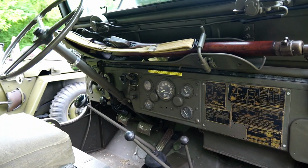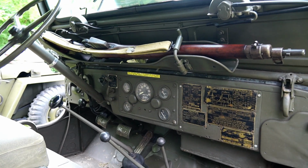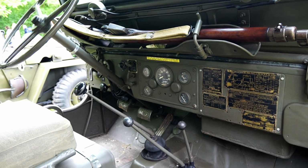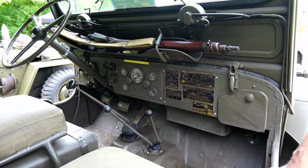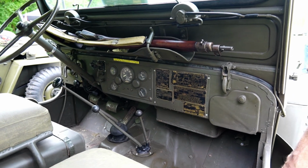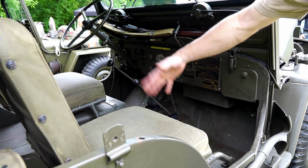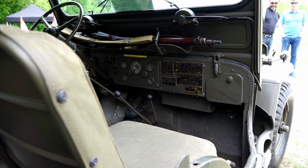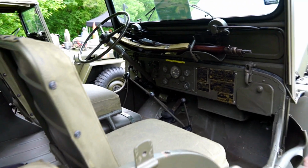Do you roughly know what the gear ratio is, especially in the first or second? Because I guess the third gear is the cruising gear. Off the top of my head, no. I'd have to look it up. The rear axle ratio I know is 5.38:1. So it's very, very low gearing. That's very low. Yeah, basically I can put everything in the basement. Step off the clutch without touching the gas, and I can walk quickly beside it and steer it if I have to. Okay. It doesn't move very quickly. Wow, that's... Yeah.